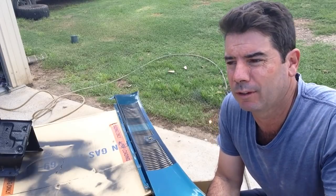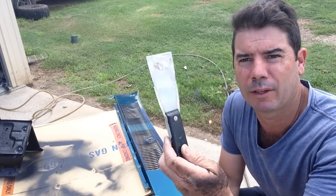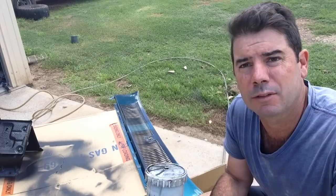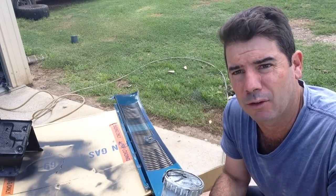Here's a little paint tip for you. Before you start spraying out your colour, check it first. Get an old paint scraper, mask off a small section, put a bit on, and then check it against the part of the car. The amount of times I've seen colours mixed up, they look good in the can, you spray them on, unmask, and then nothing like it. Check it first.